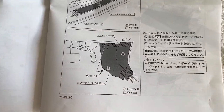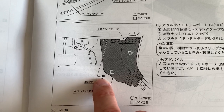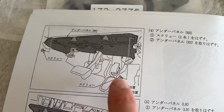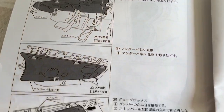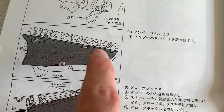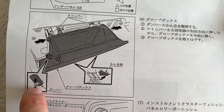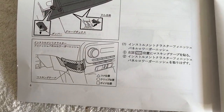The next step is to remove the door sill bits of trim. One good thing with this book is it shows you exactly where all the clips are. There's a little plastic resin nut you have to remove on this one, and then just one clip up here. Then it moves to the under panel which has some screws. The glove box is a little bit tricky but probably similar to my Lexus — you squeeze the two sides in, it should pop out, unclip, squeeze the little retainer so you can slide the glove box out.